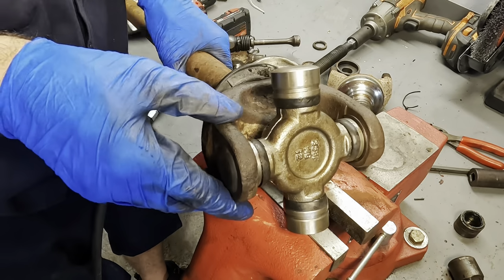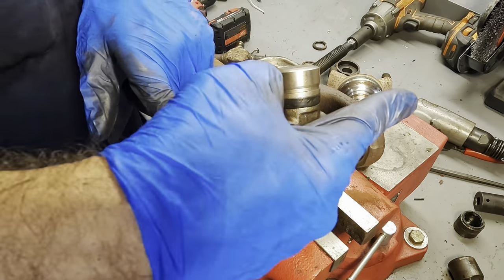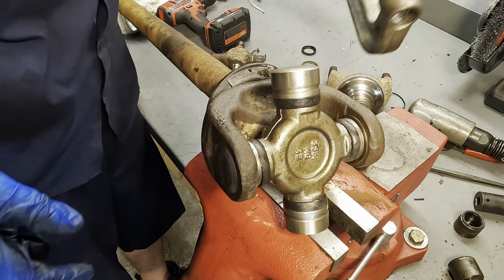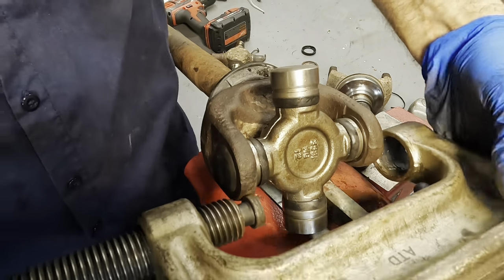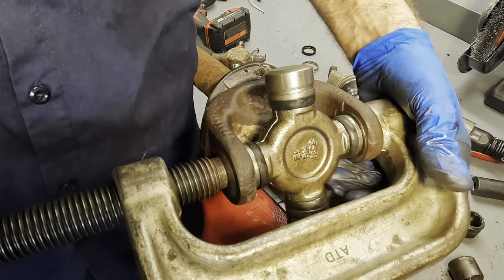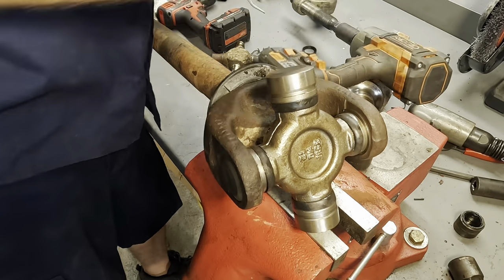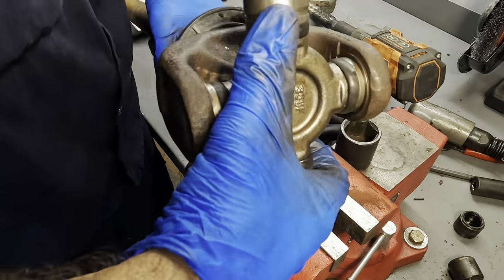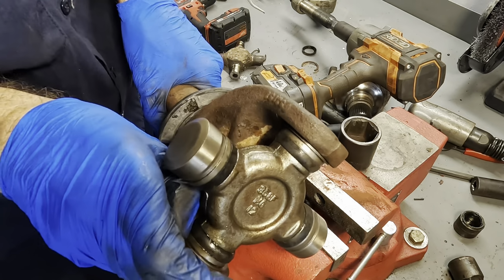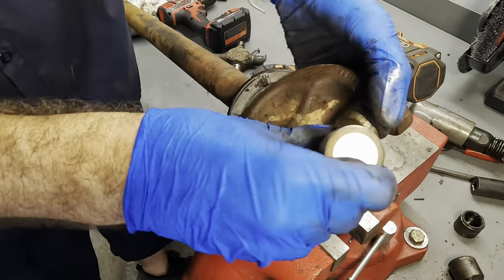Here's what I'm gonna do. This side I pressed in pretty hard. I'm gonna give this side a little bit of a press that direction, and that should help even it out some. Yeah, let's try the U-joint, ball joint press again. One more time, just a little bit of motion is all we're looking for. There we go. It's tight again, but not as bad. That side of the clip is seated out, and this side, that one's also nice and seated. Okay, I think this is a lot better. We're good here. Nice and free, it's centered.